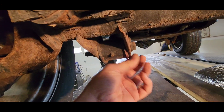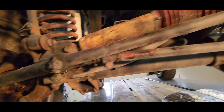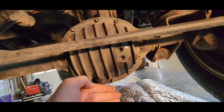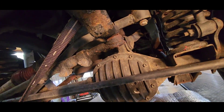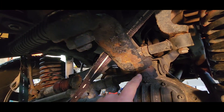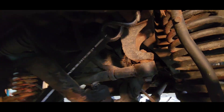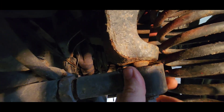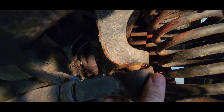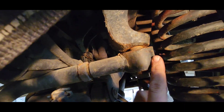You're also looking for rubber hanging out - that's something I'm going to have to adjust. It's a little oily - that might have been from them checking it, but it's gonna need some cleaning. Looking around here - nothing but grease. But up here, see all that red rust? That's because I can't move it - it's got pressure on it. The nut up here is loose.